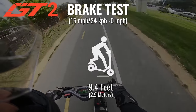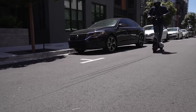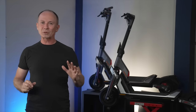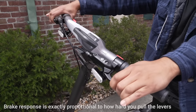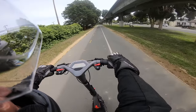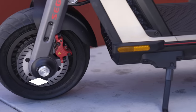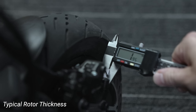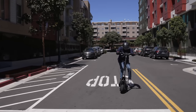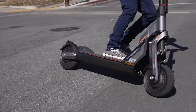The GT2 and GT1 stop from 15 miles per hour in just 9.4 feet and 9.5 feet respectively, beating every beast scooter we have ever tested, and they do it in a very unconventional way. There's no regenerative braking, so your brake response is exactly proportional to how hard you pull the levers, giving you more control. They also use a different brand of hydraulic brakes than we've ever seen — they feel better than Nutt brakes or Zoom brakes, and about the same as the Logan brakes on the Burn E2. The most surprising design choice are the 140mm rotors — smaller and thicker than rotors on most beast scooters. The smaller diameter makes them less grabby, so it's easier to avoid skidding, and being 38% thicker makes them resist warping, bending, and overheating, so brake response didn't fade after repeated hard use.